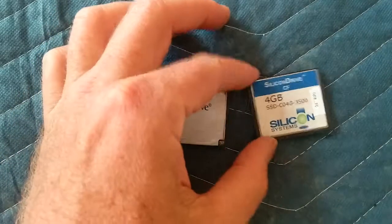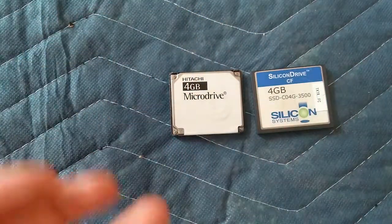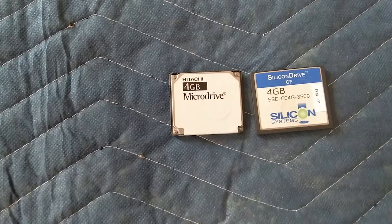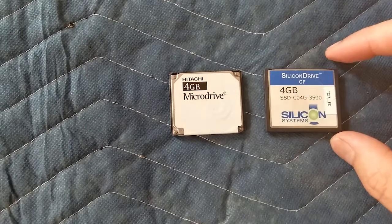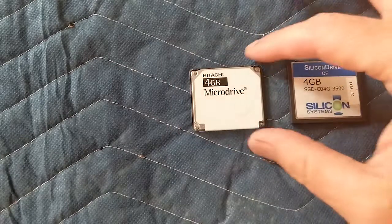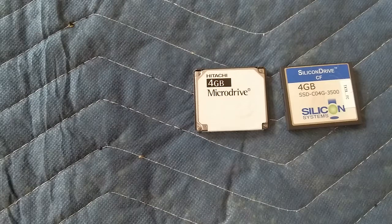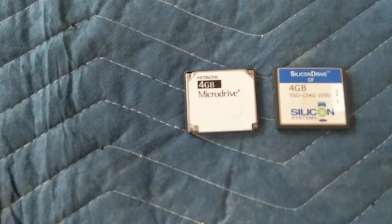Most people will want parts that aren't going to spin. On XP you've got your swap file constantly reading and writing, so doing that on a flash card means it'll wear out fairly quickly. I have devices that use 64 meg cards and every now and then one fails — it just wore out from too much reading and writing. That was one downfall of this guy too: it's a hard drive, so if you pound on it or drop your iPod it died. Anyway, just thought I'd show you this — the four gigabyte Hitachi Microdrive. Have yourself a wonderful day.